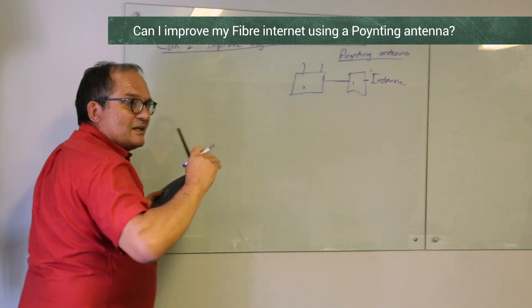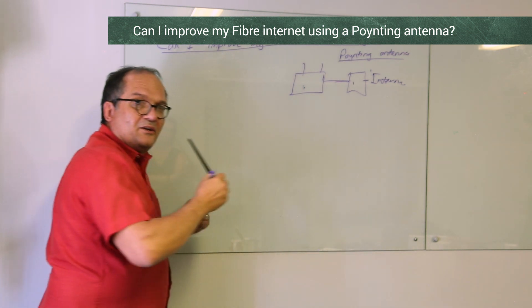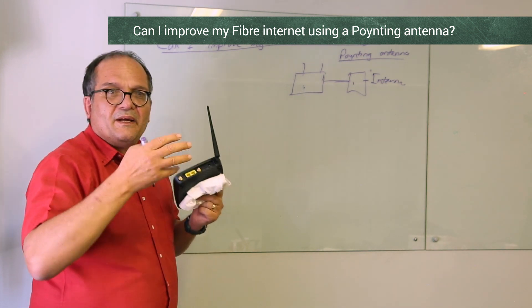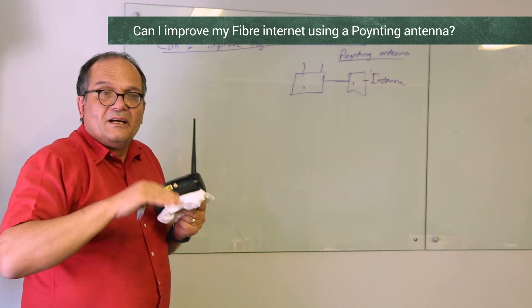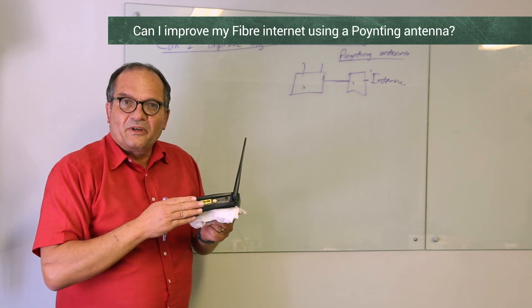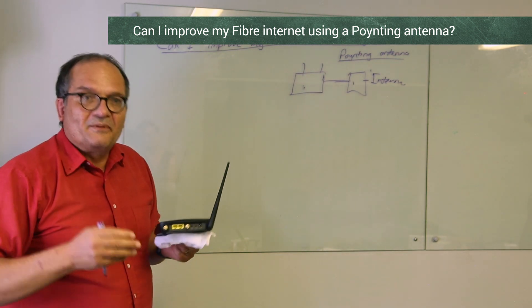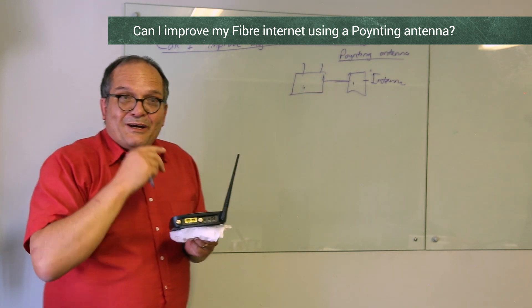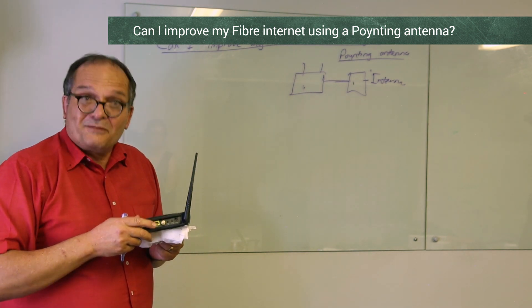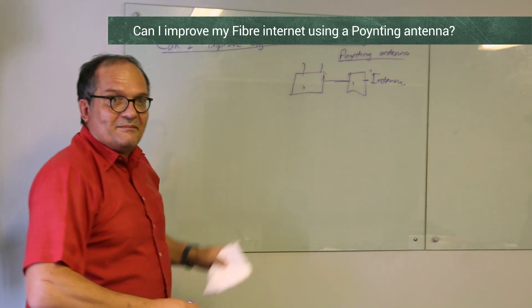Why can this Wi-Fi be improved? This Wi-Fi — nothing to do with fiber — works like any form of wireless. If the signal is strong you get high speed; as the signal goes down it negotiates lower modulation techniques with your phone or laptop. There are many videos on this for LTE, and the same applies to Wi-Fi. MIMO can create more than one path, doubling or tripling the speed. In my home using the AX standard of Wi-Fi, I actually achieved my full 500 megabits.